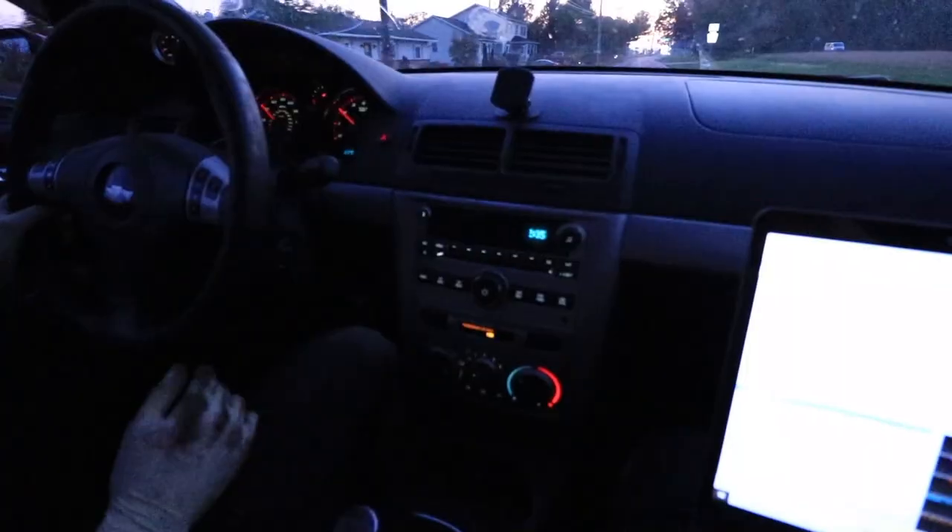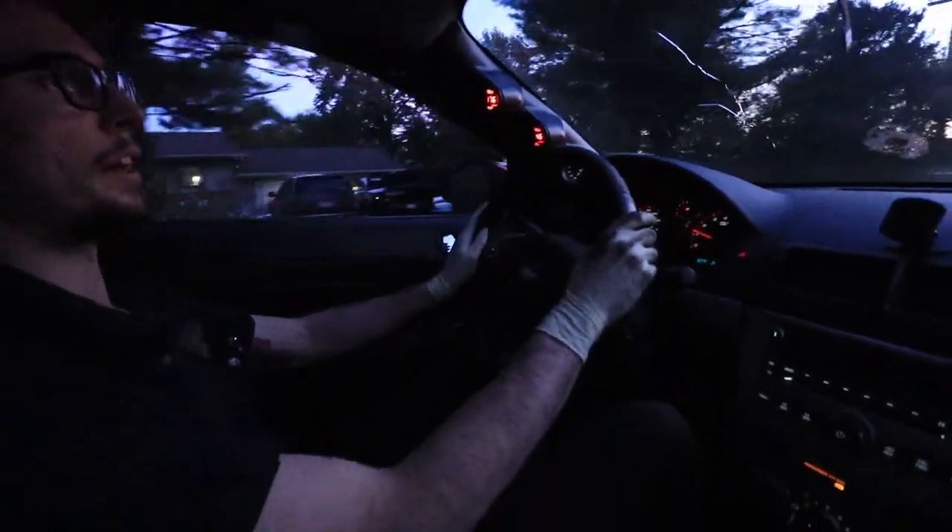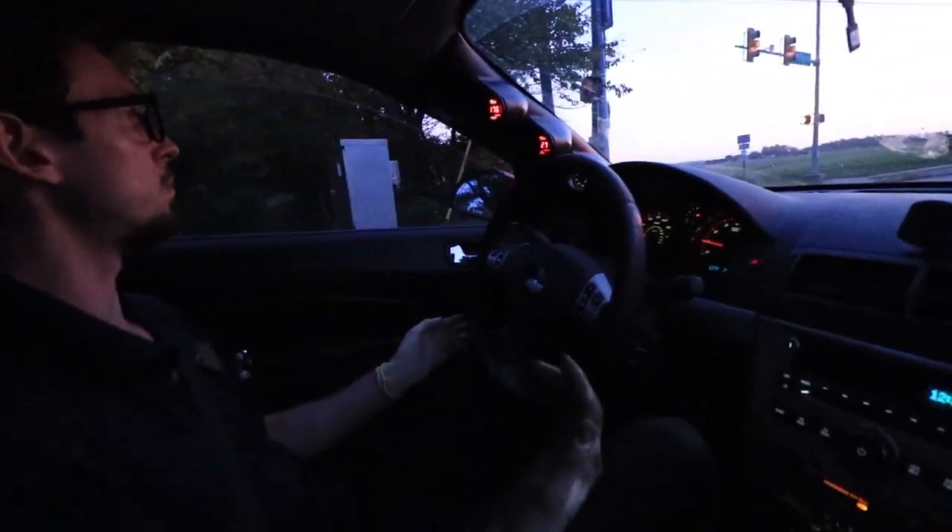Intake temps are at 110, 108 — we're doing great. As long as they stay under 120 we're solid. Sitting on the dyno running pulls I couldn't get it below 140, so this is night and day with the intercooler pump working versus not working. That's a wrap — we test drove it successfully, fixed the ground issue, and now you can see the big difference the intercooler pump makes in keeping those intake temps down.